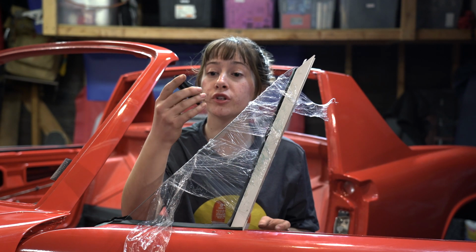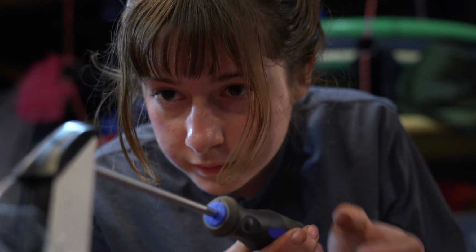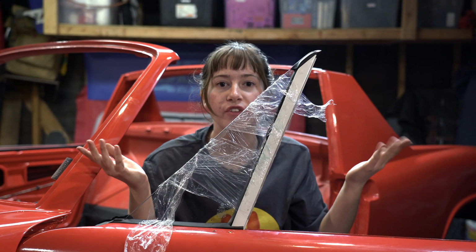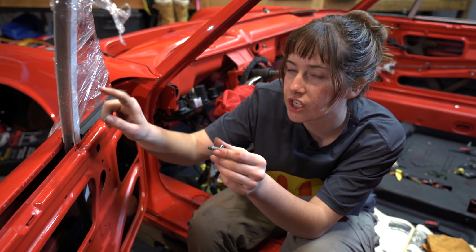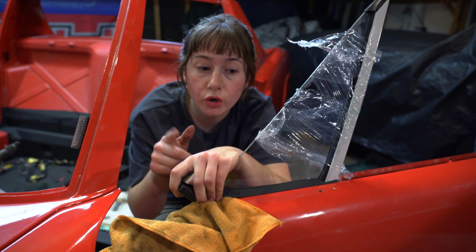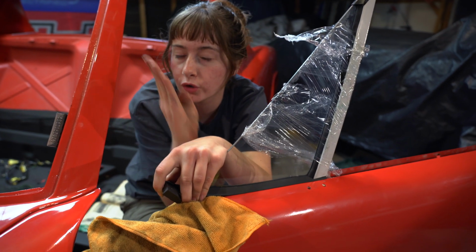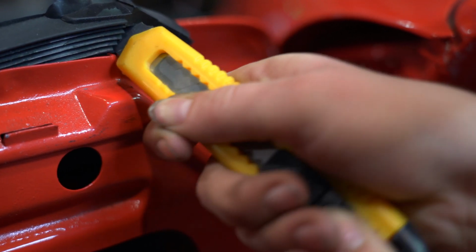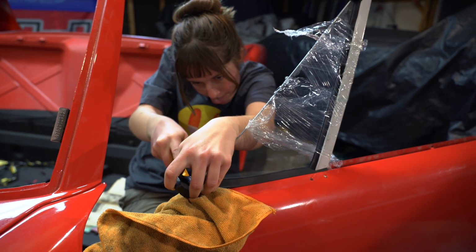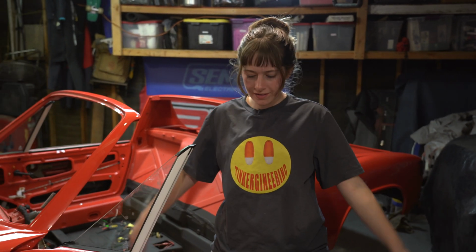This is 914 Rubber's triangle window cap and screw set. And let's test fit it. Fits perfect. Oh yeah. This is a special window adjuster bolt, and it screws into the bottom of this pillar. Because no two doors are the same, these seals are made to be kind of adjustable, so you can cut a little triangle piece to widen it out so that way it fits. A little bit of trial and error, and boom. You're met with perfection. Oh yeah!